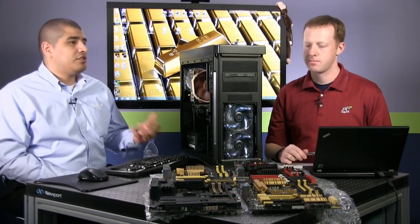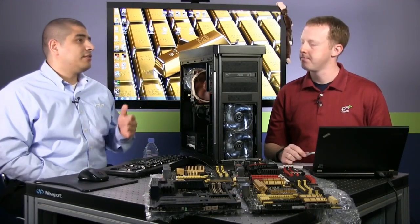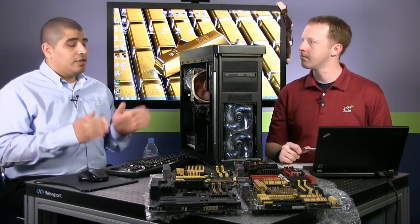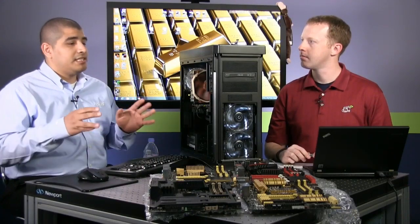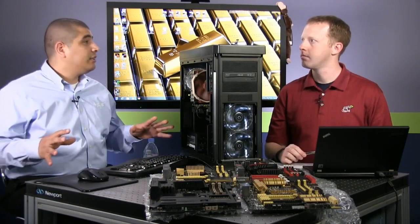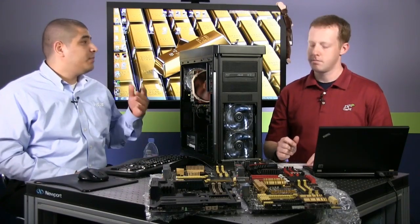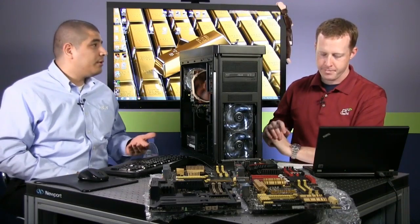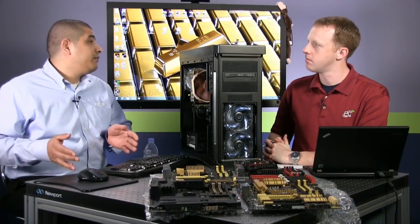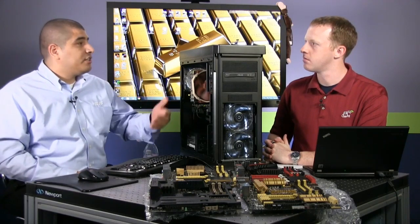It's the same way that if you check out a hard drive manufacturer, they have a SAS drive, a drive that's designed for 24-hour operation, and then they have normal mechanical hard drives. And yes, could any one of those drives be used the same way, as the standard hard drive is produced? Entirely so, right? But there are different levels of functionality and even validation. One has been designed and tested to run 24 hours, and the other is still a very reliable product. Could you probably even run it 24 hours? Yes, but there hasn't necessarily been that extensive level of validation or attention to the way the product's been designed.